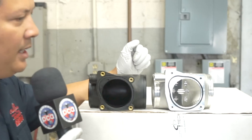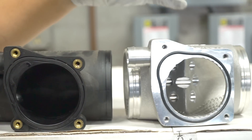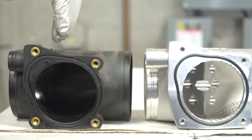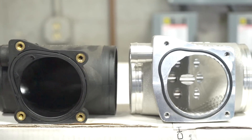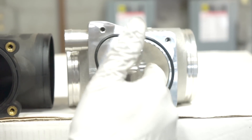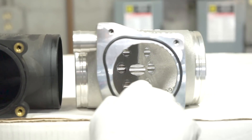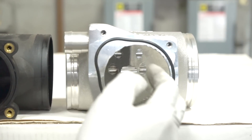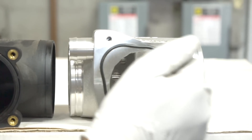I've read the IPD website. I'm not an engineer, but I'll summarize the goal of this aftermarket plenum. The factory plenum is a traditional T-shape — air comes through, hits the back wall, and gets dispersed to the sides into the intakes. The IPD plenum is internally more of a Y-shape, so the air comes in, gets divided and redirected into the intakes instead of crashing into the back wall. The interior of the IPD plenum is also dimpled, which helps create better flow. Basically, the goal is to get your engine to breathe more freely and get air into the intakes as fast as possible.